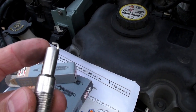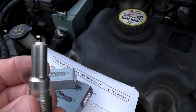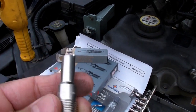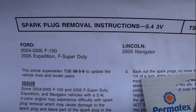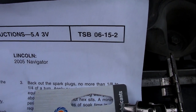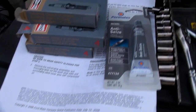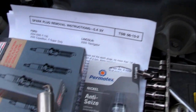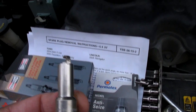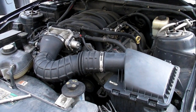See how long the snout is extended — that's the part that will break off if you have the original two-piece spark plugs. Ford did this for a lot of years. They issued a Technical Service Bulletin — here's the number — as a guide to help you get your spark plugs out without breaking them. If they do break, the TSB also has information on how to remove broken plugs. For the Mustang 4.6, the affected years were 2005 through 2008. You can tell by the sticker in the door jamb.